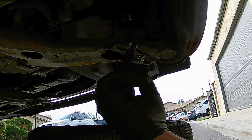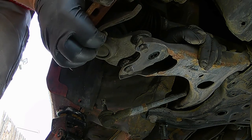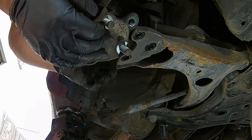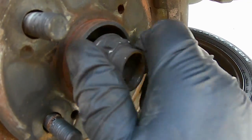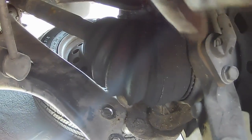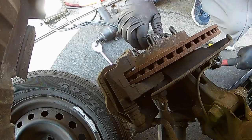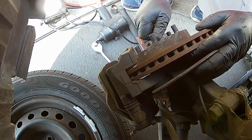We've got to get this separated from the lower control arm. As you push down on the lower control arm, pull up on your knuckle and you have them free. Now, the back of the axle — here's the front of the axle. I'll keep the axle nut on, take a hammer, and hit this to get the axle loose inside the knuckle. Once I have that loose I can pull it from the wheel side. Take my ball peen hammer, just tap it here — and it's loose, it's coming out.